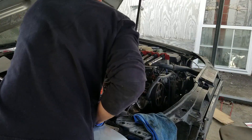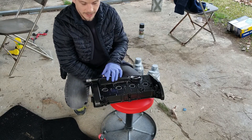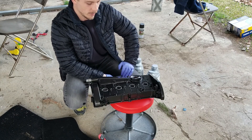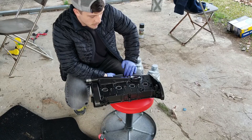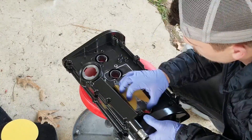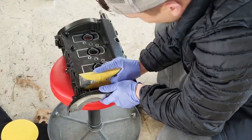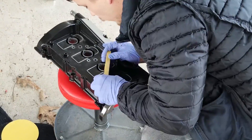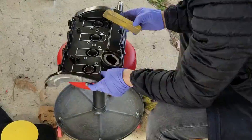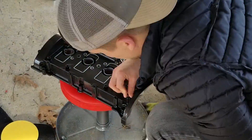Now that that seal is taken care of, I went ahead and rotated the crankshaft just to make sure everything seemed like it was still working right. It looks good — the seal is good, the half moon seal is where it's supposed to be. I tightened everything back up. Now we're going to go around and clean up this mating surface right here and make sure it's super clean. The valve cover is drying behind me, so by the time I get that done the valve cover should be dry. I'm going to clean the mating surface on that and go ahead and mount it back up. The paint actually takes 24 to 48 hours to cure, so I've got to give it another day. At 24 hours, anywhere I've got a machined surface I'm going to sand off the paint just to add a little more detail.